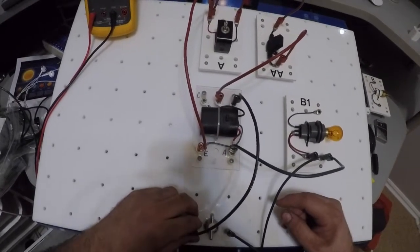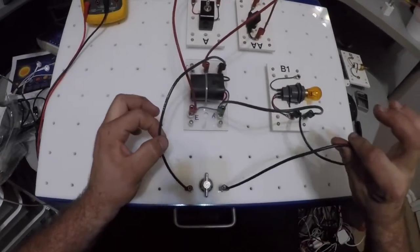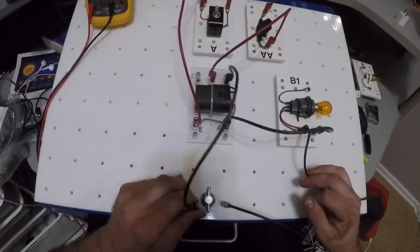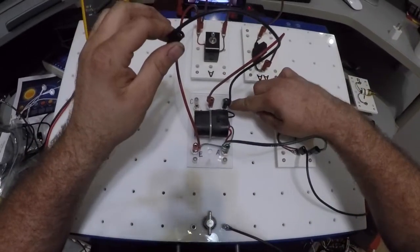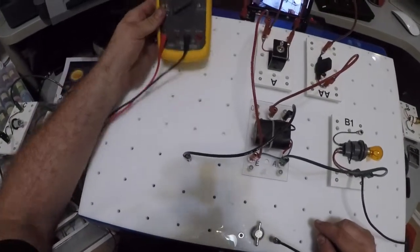Okay, so how can I tell if that is the case? What I'm going to do is I'm going to test amperage. Okay, remember, I got technically two different circuits here, right? So I'm going to disconnect this circuit. This circuit goes to my control side of the relay. I'm going to go into the board. Okay, and then I'm going to bring my meter over here.